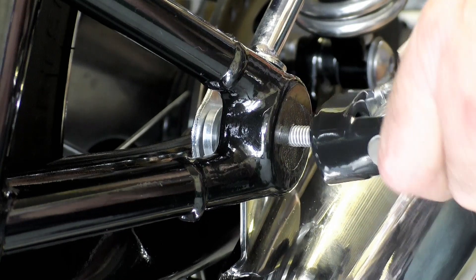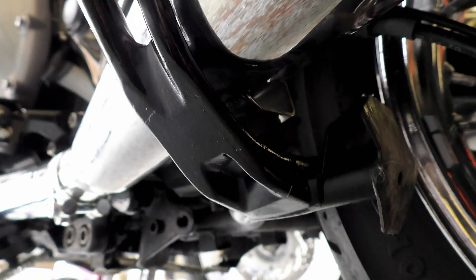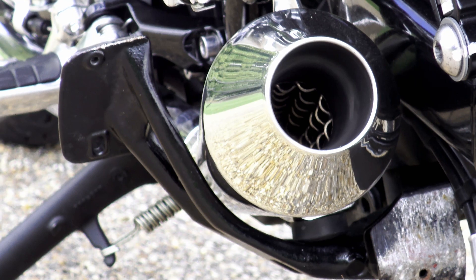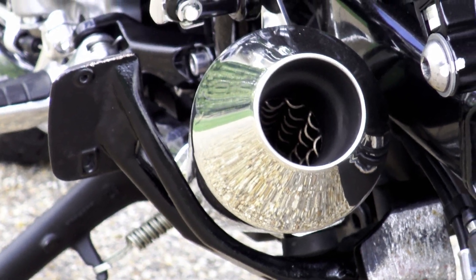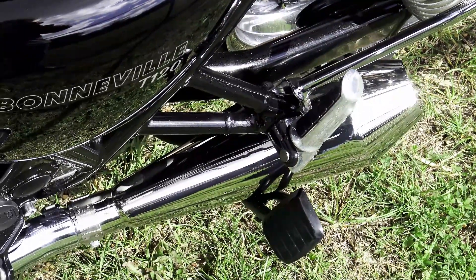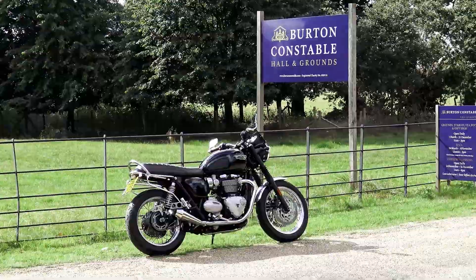On the underside of your left-hand Predator Pro Shorty there is a little bracket with a hole in it designed to accept your rubber bump stop for your centre stand. You can either use the spare one provided with the British Customs kit, or like I did, just remove the bump stop from your old silencer and place it onto your new one. One last thing to look out for is your centre stand — when it's folded up out of the way, you may need to manipulate the new silencer very slightly. When the centre stand is folded up it should only touch the rubber bump stop, not the silencer itself, so make sure you've got this lined up properly before tightening your exhaust clamp or main bolt.